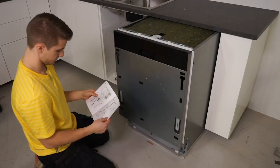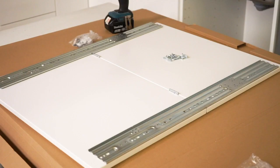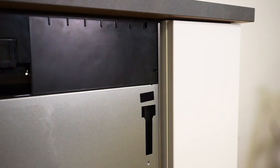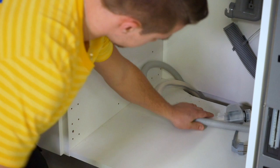Place the dishwasher under the worktop. You need to install the cabinet fronts before attaching it to the cabinets. Adjust the height of the legs at the front and at the back, and make sure the dishwasher comes all the way up to the worktop. There are various solutions for how to fit water pipes and electrical cables — here we fit them into the cabinet next to the dishwasher.